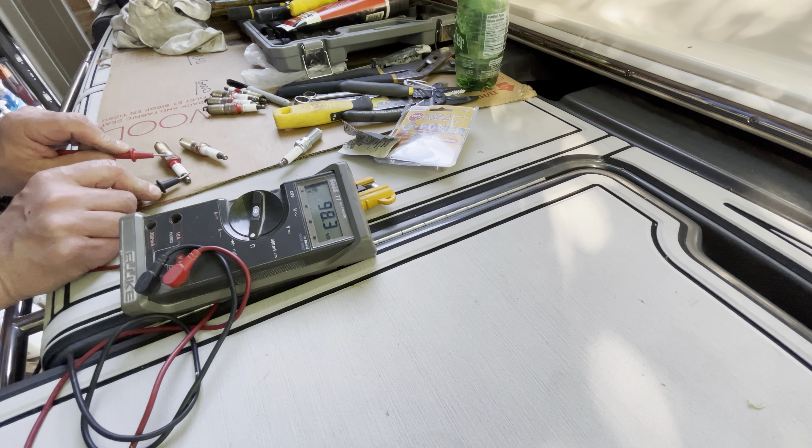There are only two things present inside the cylinder: one is gas injected under high pressure — because this is a direct injection engine — and a spark. You have fuel under pressure that is being ignited by the spark. If the spark is not present, you don't get an ignition and the fuel will exhaust through the exhaust. We did smell some fuel in the air — that was the indication. So anytime you smell fuel and your engine is running a little rough, think about it — you're probably not getting a spark inside the cylinder.